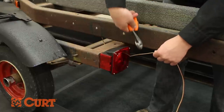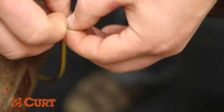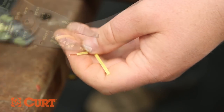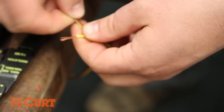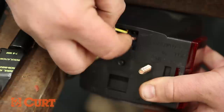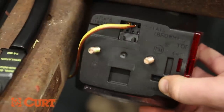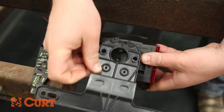Using the tail light as a guide, trim the trailer light wire. Strip the driver's side tail light wires and twist the exposed wire ends. Insert the wires into the back of the tail light using the designated color connection points, making sure wires are fully inserted. Route the wires carefully from the connection points through the wire rail, allowing the wires to be flush with the plastic backing of the tail light.